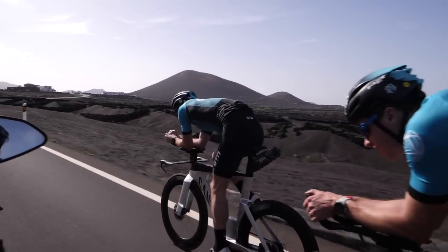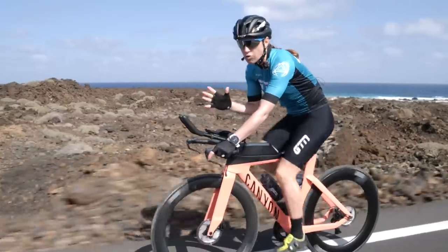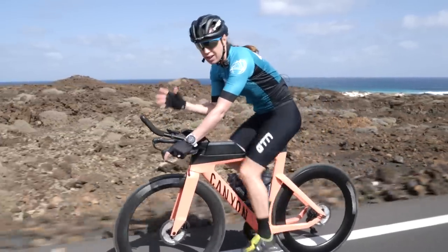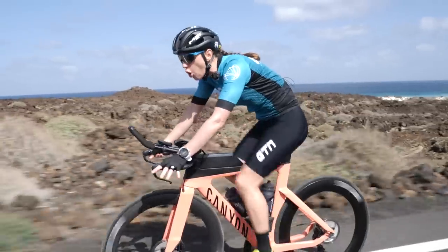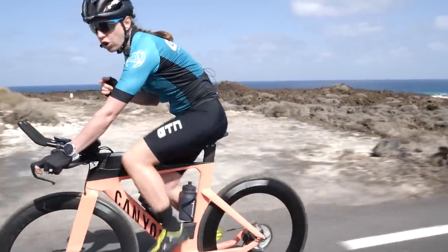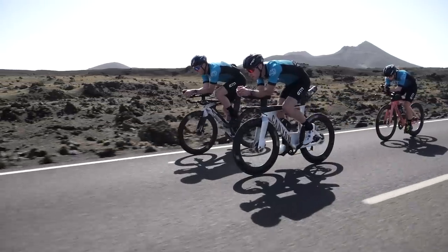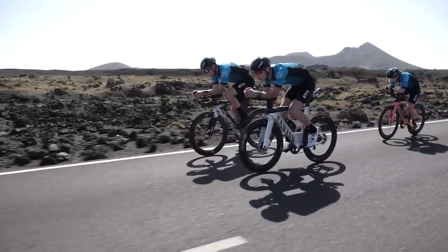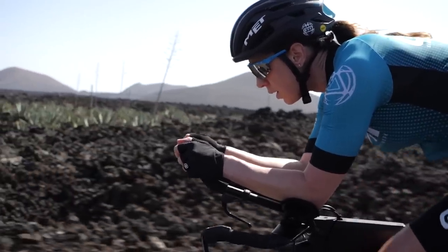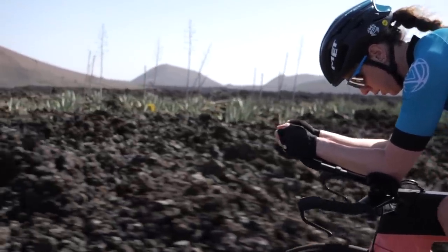I think we've exhausted the bottom — it's time to move forward. The cockpit, and in particular the TT bars positioning, needs to work in relation to your saddle position. Finding that right reach is vital for comfort, but also finding a position that you can maintain for this length of time. If you're too stretched out, you might look really aero, but you're going to struggle because your core and your back is going to be working really hard, and you'll probably find that you're holding really tight with your hands as well to maintain that position. Start by making sure you're totally happy with the position of your saddle, and then you can adjust the front end. Most TT bikes have plenty of options for alterations. How low you have your front end will depend on your flexibility and strength. Remember, you'll need to be holding this position for long periods at a time. Once you've decided on the height of your bars, you'll then need to experiment with the angle of the bars and the distance from the tips of them away from the nose of your saddle, as one affects the other.